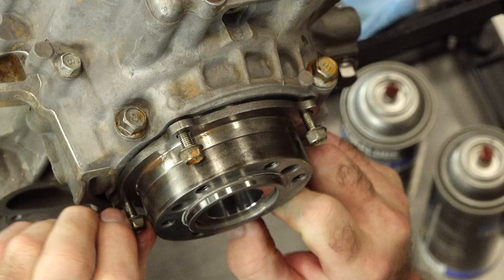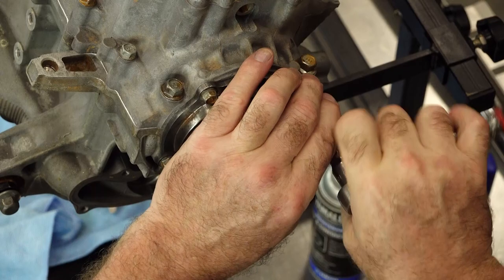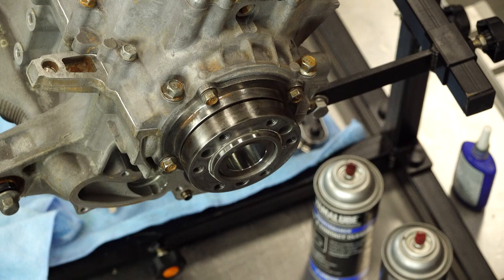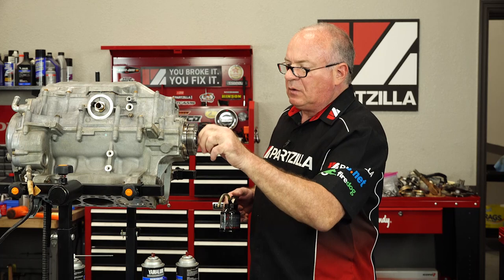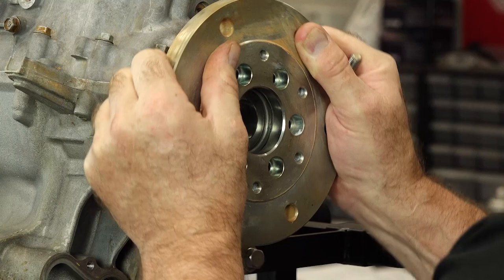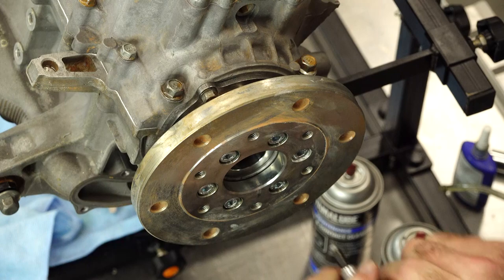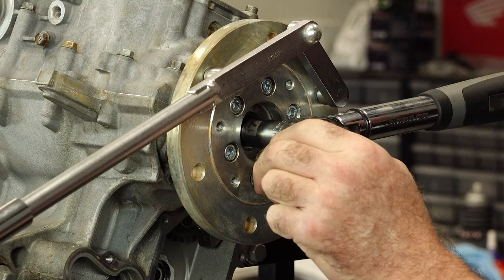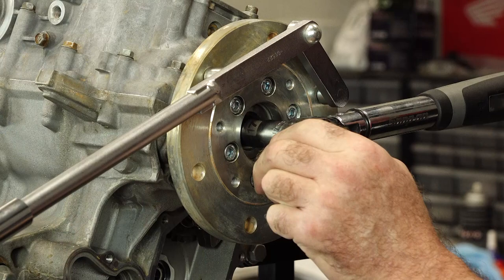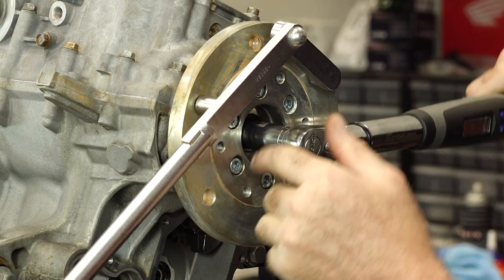Let's go in. Make sure that O-ring goes in all the way around. We bottomed out on the crankshaft, so now we need to use our flange mounting bolts to go ahead and pull the housing all the way in. A couple of turns on each one to pull it in evenly. We're going to take those to 8.8 or 9 foot-pounds. Now some oil on our main bolt and on the head of it. We're just going to bottom it out, then put on our flywheel. Then we'll have to hold the flywheel to tighten this bolt. Just be careful when you're getting it to lay flush — it may take a little bit of rocking it back and forth before it finally seats in. Don't force it with the bolts — you want it completely flush before you start tightening those down. All right guys, we've got the flywheel mounted up. All our bolts are in place. Now it's time to get it torqued. We've got our holder in place, and we're about to take that center bolt to 87 foot-pounds. We'll leave the holder on there and then go back and hit all six of these mounting bolts to 27.